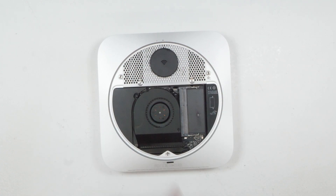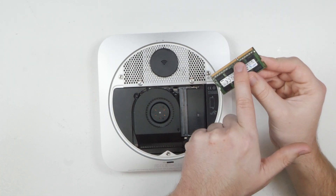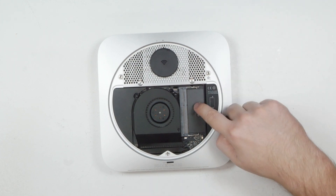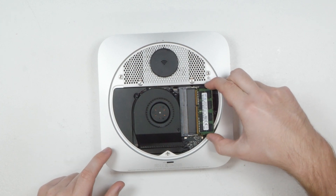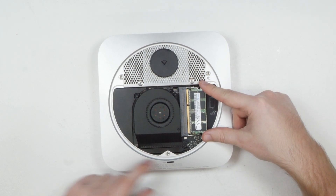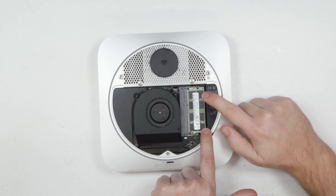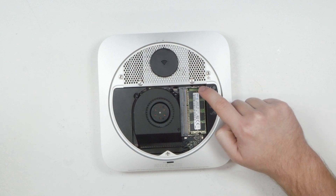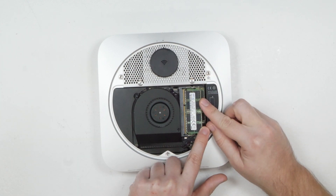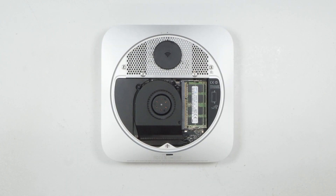Now get the fan and plug it back into the header on the motherboard near the Wi-Fi antenna. Line the plug over the female plug on the board, push it down so it clicks into place, then line the screws up with the holes and screw them down. The fan is now reconnected. Now get your RAM sticks — make sure the notch on the stick lines up with the notch in the slot so you have them the right way around. They only go in one way. Angle them in at roughly 45 degrees into the slots, push in until seated in the socket, then push down flat so the clips on the side clip in and hold them. Do the same with the second stick.